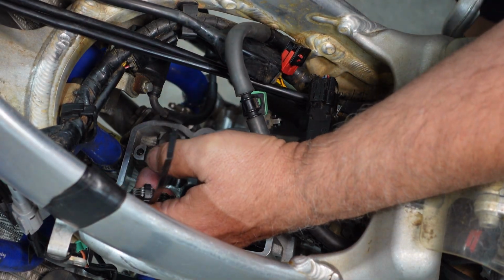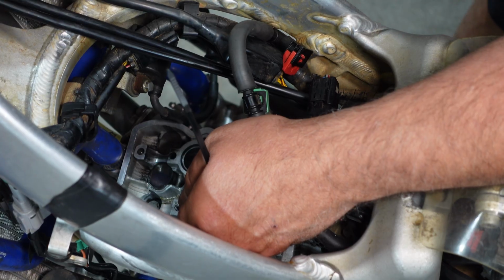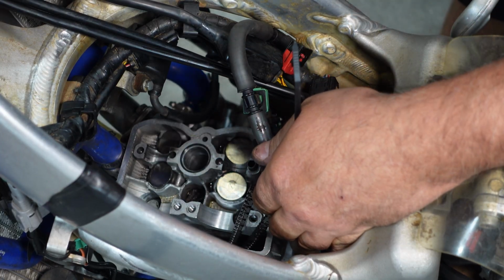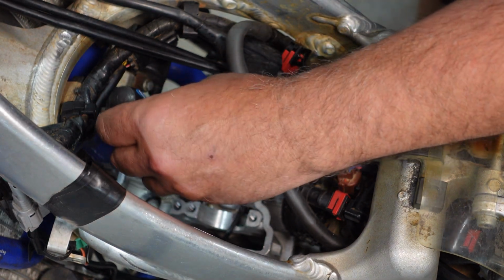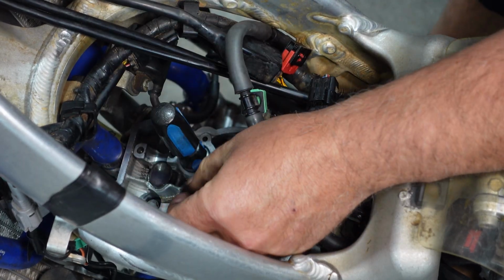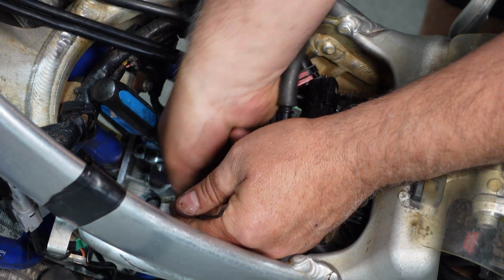Go ahead and hold this timing chain and run the engine around. And it feels fine. There's no drag whatsoever. And I'm just going to go ahead and get this back up on top dead center. At this point here, without the camshafts in, it doesn't really matter. There's only going to be one top dead center at this point. And at this point here, you can rotate the engine forward and back if you have to.